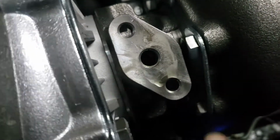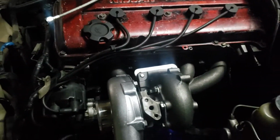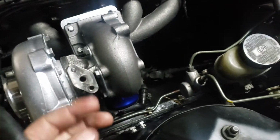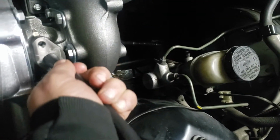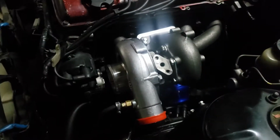If you look really closely, you can kind of see some oil residue. A lot of turbos from the manufacturer get some sort of lubrication inside, which is fine. You probably don't have to do this. In fact, right before you start your car, you could pull your ignition or fuel pump fuse and just crank it and let oil pump through everything real quick, which I'm going to do anyways. But it also doesn't hurt to put a small bit of oil all the way through, until this starts to fill up to the top. Almost knocked my beer over. Just put a hose right over it, and then blow on the other end, which I can't really show you, to blow it all through and let it do its work, and then add some lubrication right before you start it. So that's smart to do.